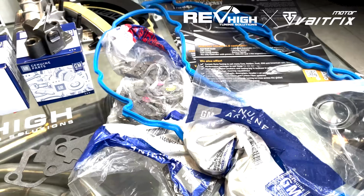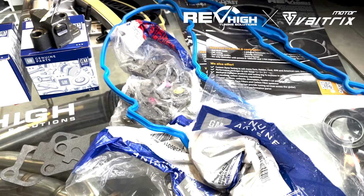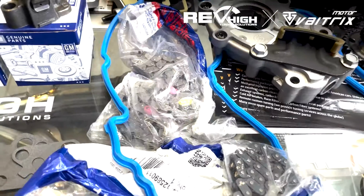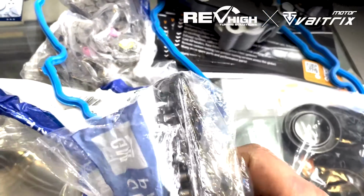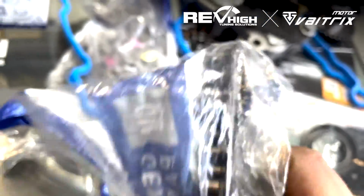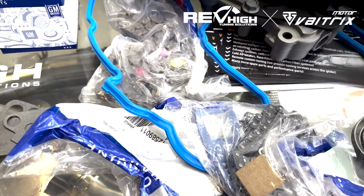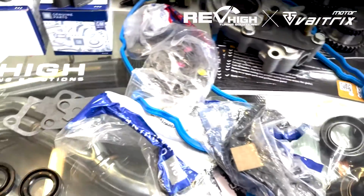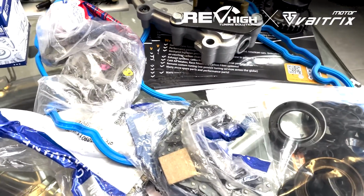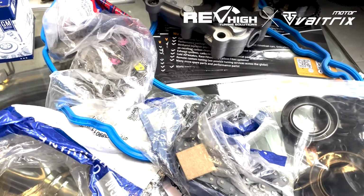In terms of the chains, the general accepted changeover period on the chains was August 2006. The earliest style are a roller style or bicycle chain. Anything VZ up until August 06 or VE up until August 06. Anything after that is Morse. There are some weird changeover dates. Sometimes they put an older engine. Holden may have had some spare engines at the Elizabeth plant and put them into later model cars.